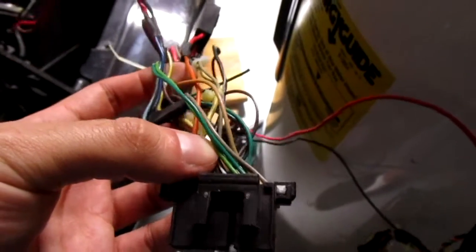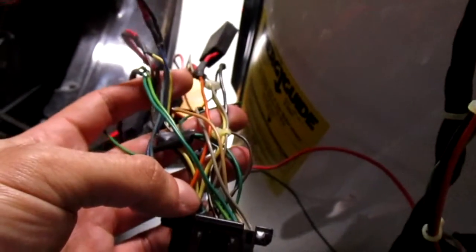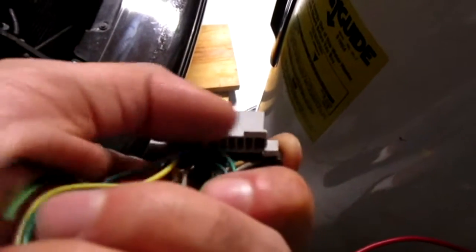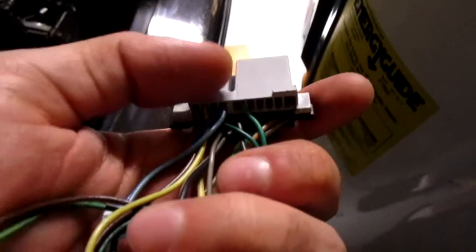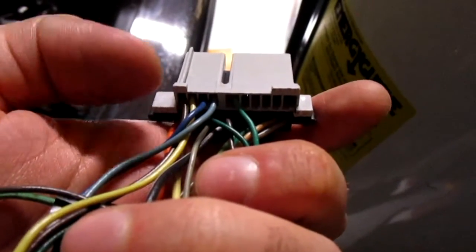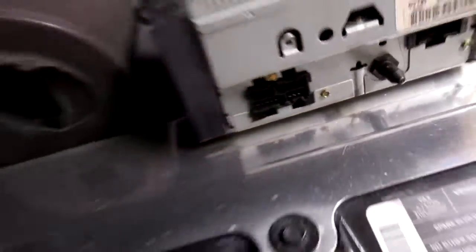You have like a main power wire, a battery wire, a key-on wire, one for the lights, and so forth. You just got to figure all that out and then put your connector on. Wiring color changes on some of these — they use a different wiring color, like the holes in the Buick — but all the pins are the same. You got to match up the pins. Usually they're labeled, or you get a picture of the actual connector, and it's either by letters going across or numbers. So you look at that and match up — if, say, light blue was pin D, you look at D and find that. It's easy. If I figured it out, anyone can do it.